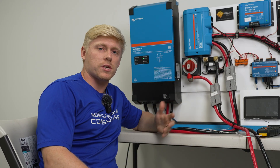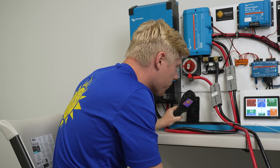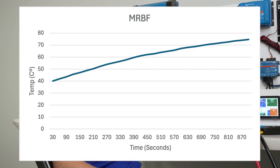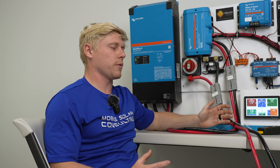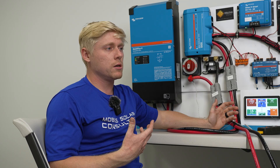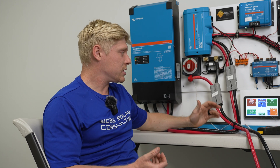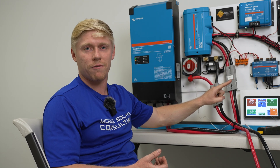We've got the new fuse in — let's get things heating up. The max temperature that the MRBF reached was about 75 degrees Celsius, which is about 167 degrees Fahrenheit. For the Class T, we only reached about 63 degrees Celsius, which was 145 degrees Fahrenheit. Both of those are safe and within what the cables can handle — the cables can handle about 90 degrees Celsius. They're both hot to the touch, but with the Class T I can safely leave my finger on it for three to five seconds; with the MRBF I definitely could not touch it for more than two seconds. I definitely prefer the Class T for that reason.